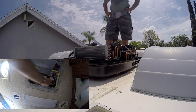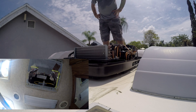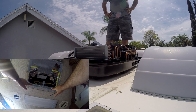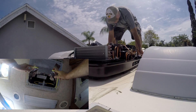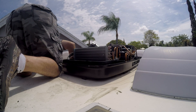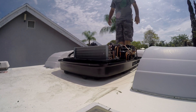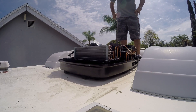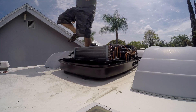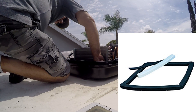These are the instructions for putting the ceiling plate on: hold the ceiling plate up to the opening, be sure the large plate faces the rear of the ceiling plate, then start each mounting bolt through the ceiling template and up into the unit base pan by hand — you have to find the hole. Check the gasket of the unit over the roof opening and adjust as necessary; the unit may be moved from below by slightly lifting but very little. Then tighten the bolts to compress the gasket down to a half inch, evenly tightening to a torque of 40 to 50 inch-pounds, which compresses the roof gasket to approximately a half inch. The bolts are self-locking so further tightening is not necessary.